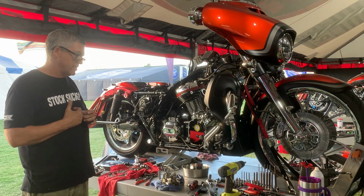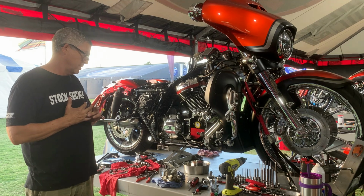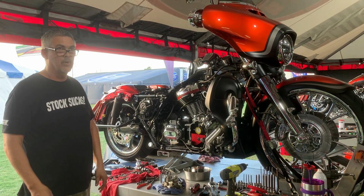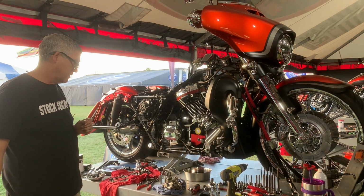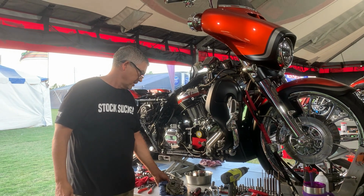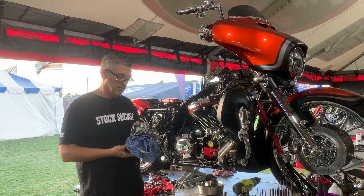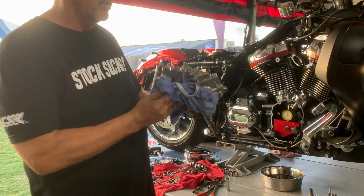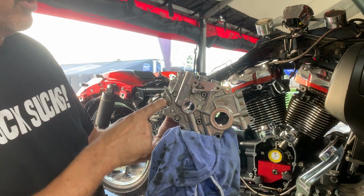The purpose of this video is kind of to talk about things you should pay attention to. If you're going to do one of these big upgrades, you better make certain that the guy doing the motor pays attention to parts that are inside. In this particular case, this engine was built around the pump. It's known to sump like crazy, and this bike is a sumper. So this is the very original oil pump for the oil-cooled bike, and the part number in this thing was basically the one we looked for, 0141.